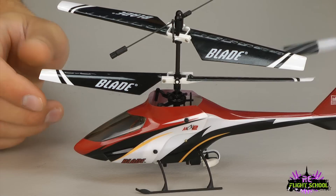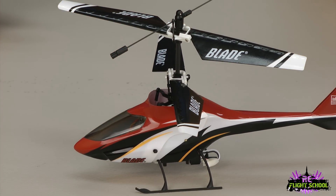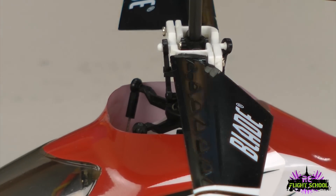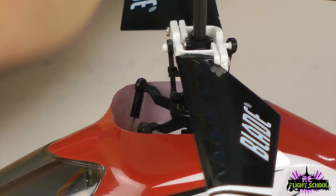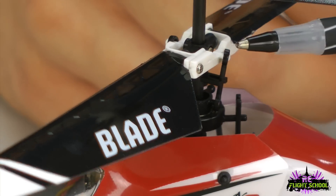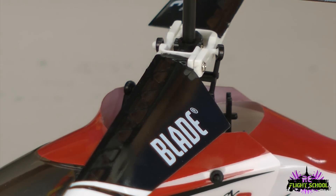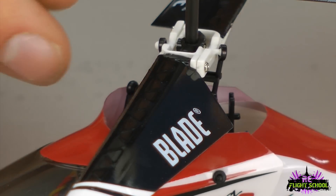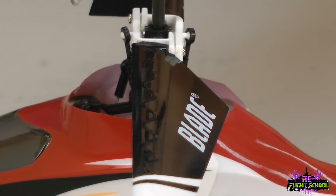Next, we'll move down to the lower set of blades — this is where all the control comes from. The lower set of blades is actually what tips your helicopter forward and backward, right and left. Now if I zoom in real tight here, you'll see that we do have a link that is pressed over the ball link. You can see the ball sticking out and the link is all the way against the blade. If you look on the other side, you see it's resting properly on the ball where it should be. Little things like this can make the difference between crashing your helicopter and a full day of flying. I'm going to pop it out where it should be on the end of the ball, and now you can see it's perfect.